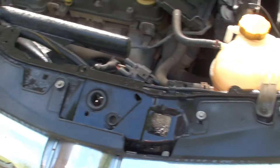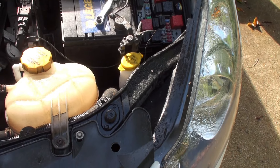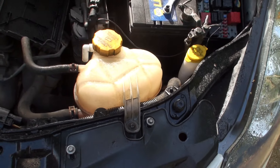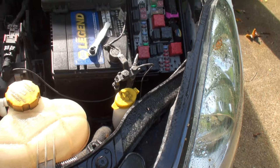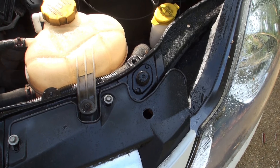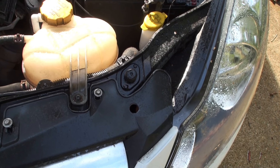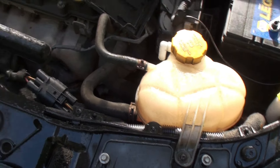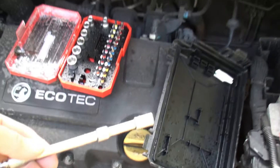Here's the offending car. I've never seen such a convoluted procedure to change a headlamp bulb. The manual is completely useless. I looked at a few videos online but they weren't very clear, so I thought I'd go over it myself. What you're going to need is a small socket set - you need an 8mm socket - and also a longer bar because one of the headlamp bolts is down through a hole underneath.